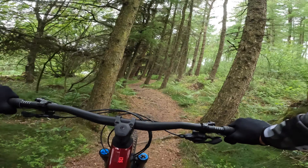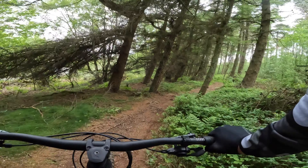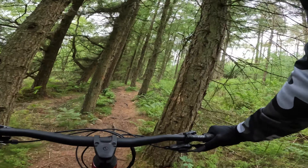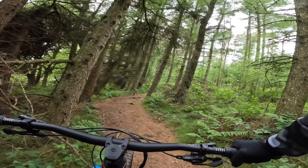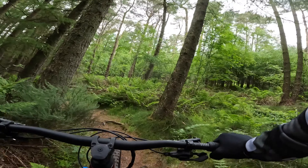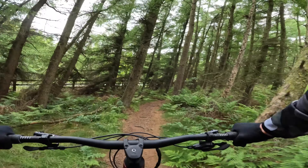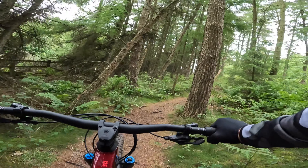Might just have a play around with the rebound — even though the wheel weights are very very close, it feels like it's a touch faster than it needs to be now, touch livelier at the back end. For now it's not pedalling great, but to be fair it's pretty damn sluggish with a double 29 on. If anything it feels a little bit brighter and not as muffled — psychologically it's a better pedal. Basically feels like I've got more low-speed on in the old-fashioned sense, and I've actually got less than the last time I pedalled up here.